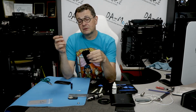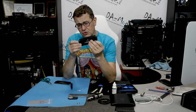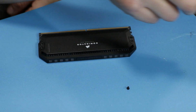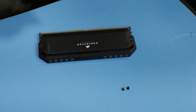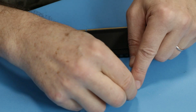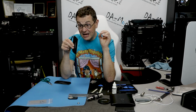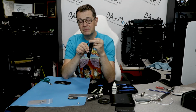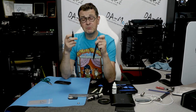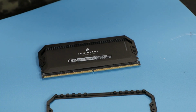First of all, in order to remove the light from this module, you need to unscrew those 4 screws. But essentially it's like one screw into another screw and they go through the hole. So when you start unscrewing it, both spin freely, nothing happens, and you need to scramble and find a second bit, which I didn't have in exactly the same size. So with one bit you're holding one screw, and with the screwdriver and second bit you unscrew the second screw. The beginning was already a little bit frustrating, so great.